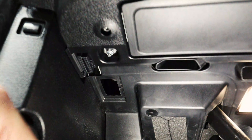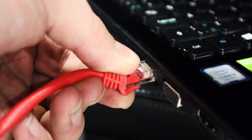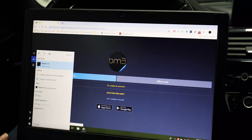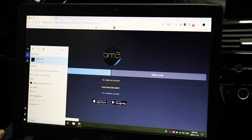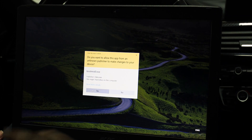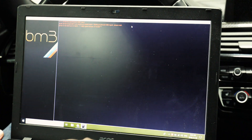First, we connect the OBD2 to Ethernet cable from the vehicle to our laptop. This cable is available from multiple sources, and when purchasing your Bootmod3 license from Toge Tuning, we can unlock and flash your car at our full service shop. Next we fire up the Bootmod3 OBD agent program that was pre-installed and downloaded on our computer. The program may ask for additional authorization before continuing, and a small screen will pop up to confirm the connection and details of the car.